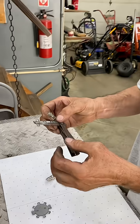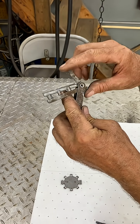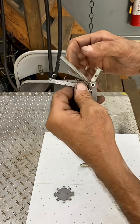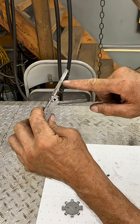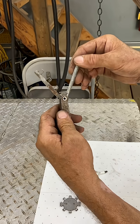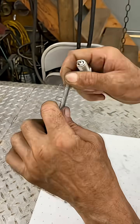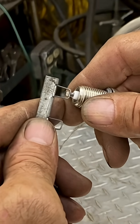Here's a different set — same thing. It's got the little bending tang tool, and this one's got all the different thousandths of an inch on there for different gaps of spark plugs. You do the same thing: find the one you're looking for, 30 thousandths, and you just rub it through there to make sure it fits.